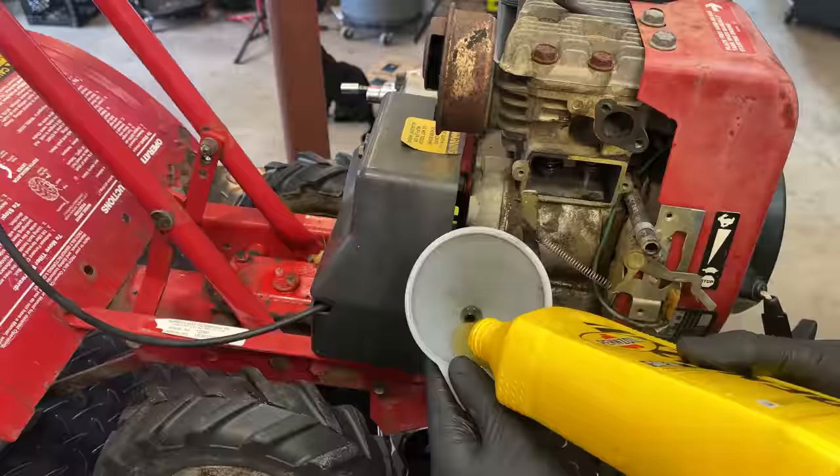The carburetor, it was actually running pretty well. I did have to lean out the pilot to get it to run and idle better, and adjusted the idle set screw a bit, and we're pretty close. I think there's really no point in fine-tuning it until that air filter is back on, so I think I'm going to do that now. We'll get the plumbing squared away, and I would say fix this as well. There's not enough tension, and once that's done, I would say the engine is there.